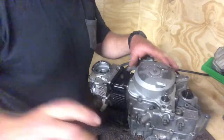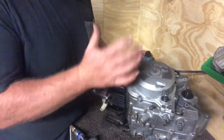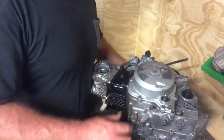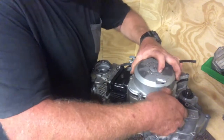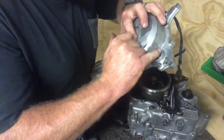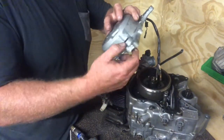I've just set up my engine on its side. If your engine is in the bike, you can shut the fuel tap off, drain the fuel out of the carby, lay the bike on its side and do the same thing. I've taken out the screws holding this stator cover - just going to give that a wiggle and pop it off. I'll also replace this seal here, the gear shift lever seal, since I'm replacing all the seals on the engine.